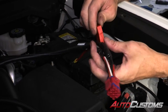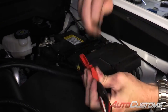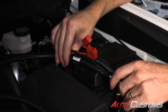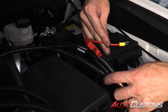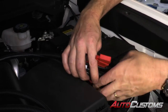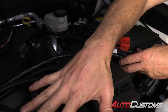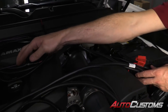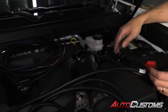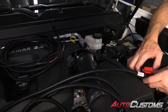Here's our wire harness. First and foremost before we do anything else, we're going to go ahead and remove the fuse and set it out to the side to reinstall later. Now we're going to run this wire harness. We've got the positive that's going to go to the positive, and the negative is going to go to the negative terminal. I've already got the harness divided into two sides. The longer side goes to the passenger side. The shorter side with the purple wires hanging off goes to the driver's side. We're just going to follow our instructions and route the wire as shown in the AMP Research instruction sheet.